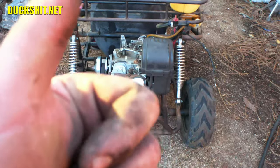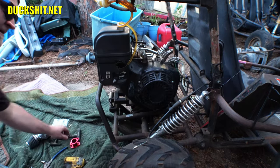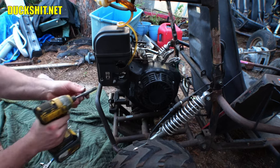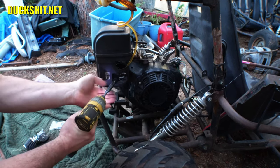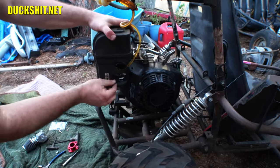All right, there it is. Yes, very happy. I'm saving this for the next video. It looks like we're gonna do it a little prematurely here on account of having throttle cable issues. The throttle cable that I have is meant for a slide style carburetor and not for the linkages that would ordinarily come on one of these.